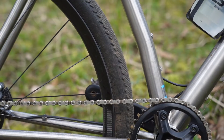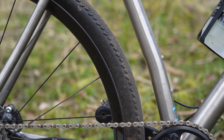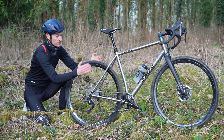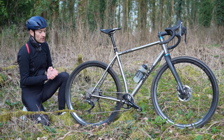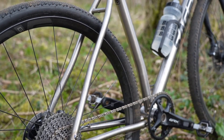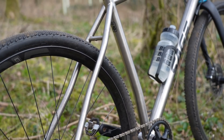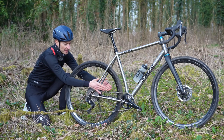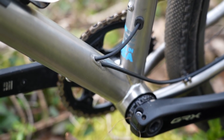The most noticeable is the very curved seat tube, which really stands out as a very distinctive detail on that bike. And what that does is allow them to keep the chainstays quite short, keep the rear wheel tucked in for a short wheelbase and nimble handling whilst improving the tire clearance at the back. As well as that curved seat tube, the rear stays are also very curved — seat stays curve around the rear tire, pinch in again, and then flow out to the dropouts. And it's the same with the chainstays. They've also removed the bridge at the chainstay to further increase tire clearance.